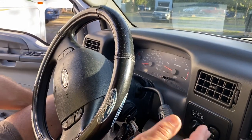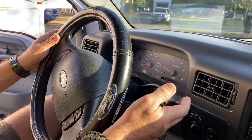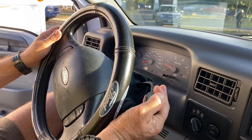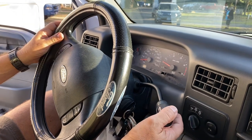Now you can put the truck in gear, then slowly the gears engage and you should be in 4x4 mode, either low or high as selected. Now when you want to switch out of 4x4, again you have to put it back in neutral, then make the selection, and then go back to drive — and the truck will be in standard two-wheel drive.